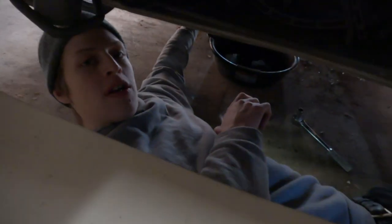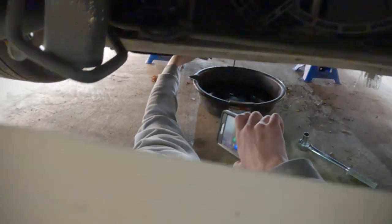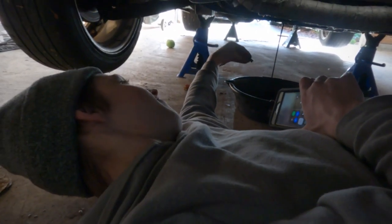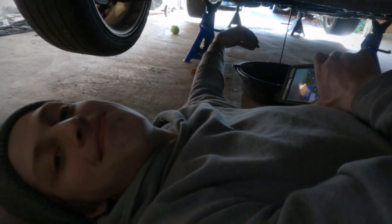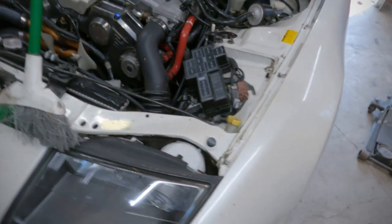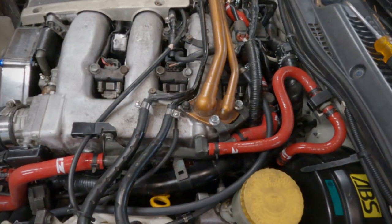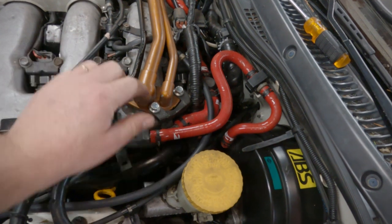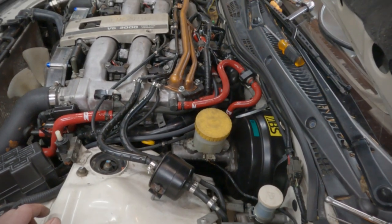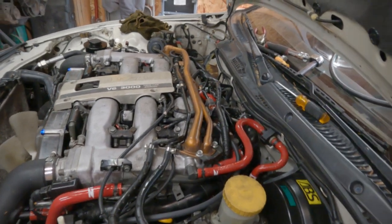This car's got some dark oil — about what you'd expect. It totally smells like gas. Good thing we're changing it. Since we were dumbasses and took the injector off the fuel rail, it kinda just found its way into the cylinders. We're gonna pull out the spark plugs and just make sure we don't hydro-lock the thing. Probably only a couple tablespoons of gas went in, but why not do it?